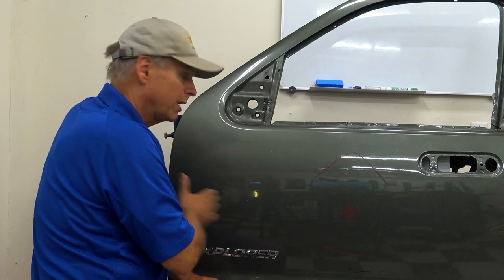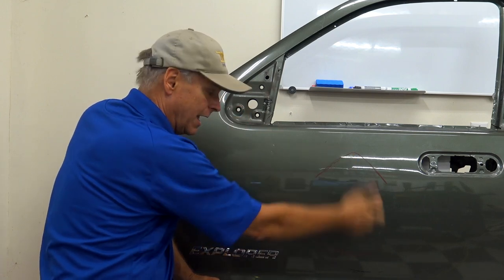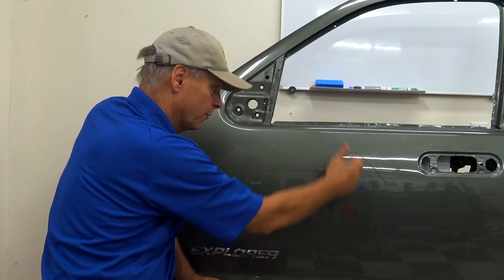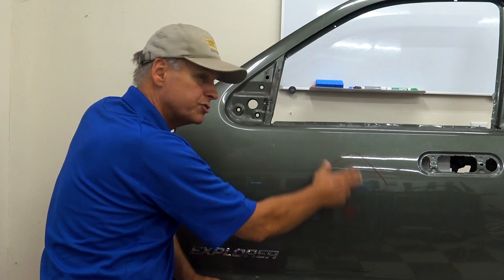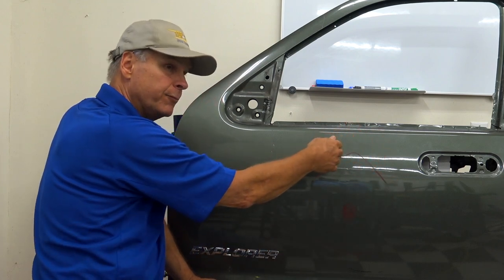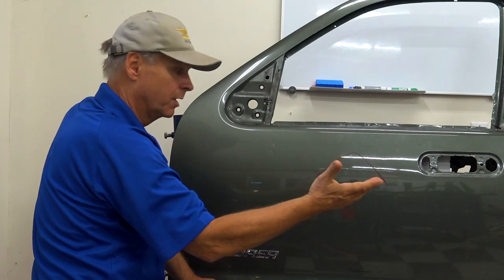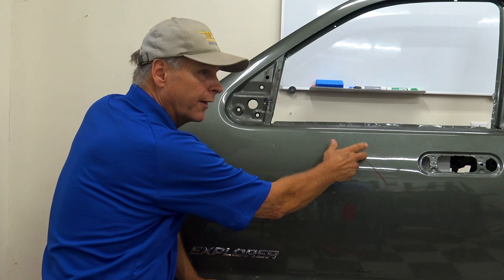So I'm not putting pressure on, I'm not watching the dent move. My 100% of my focus is right there, and if it's on the bottom, it's there. If they're both the same, I'm focusing on both at the same time. And if either one of those crowns stop moving, I immediately stop putting tension. You take your hammer, your nylon hammer, which is good. I like this metal one a little bit better, or your nice soft tap down, and you start hitting on that, help it to relax.